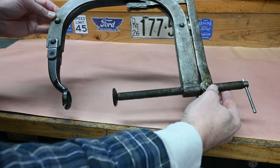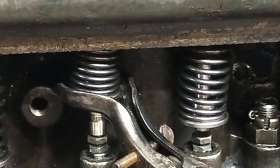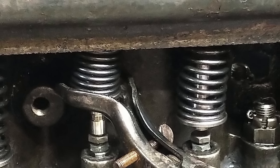I used an oversized reamer to open up the valve guides as well. The guides have apparently hardened over time, because they were really tough to ream. I found this old spring compressor in my dad's things and was sure glad to have it. Other simpler ones are also available from the vendors, and they appear to work well too.